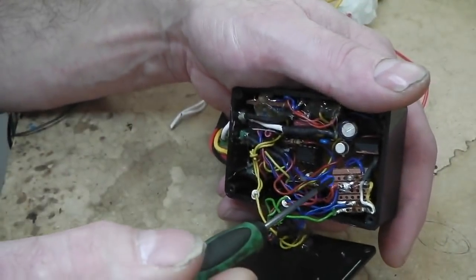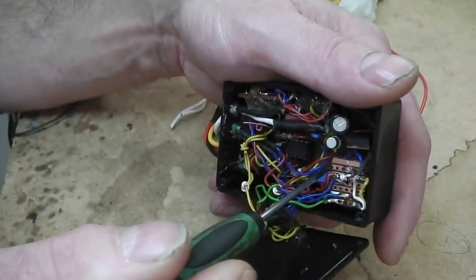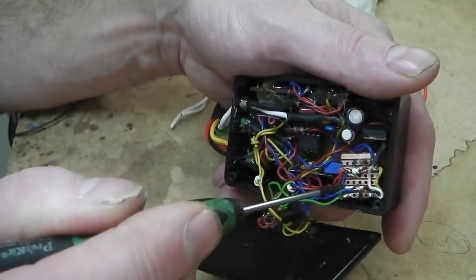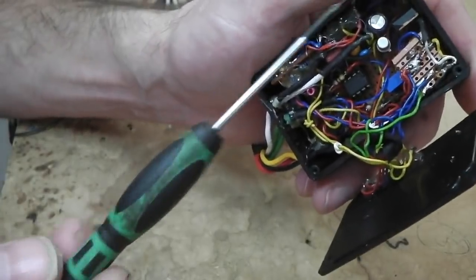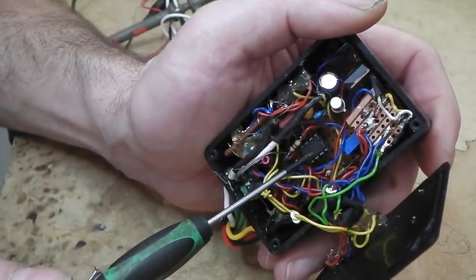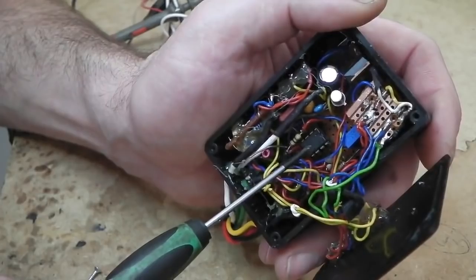Here's a stack on board, which is the delay relay. That just wants now fixing in, now we're ready. On the flip side of that little miniature piece is just another, that's the safety cutout relay. Here's the heart of it, and I've left that nicely exposed in case we had to unplug it. That's the chip, that's the 2917, that's the beauty. Look at that, it's on a socket, so I can pull that out.